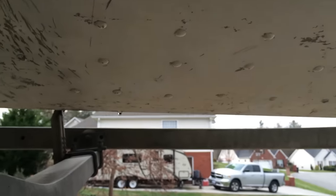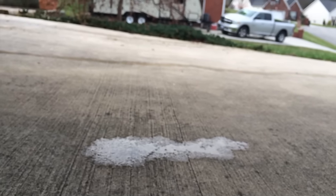We've let the water fill up in the bottom of the boat, and you will see a little puddle has developed here underneath the boat. As I get a little bit closer in, you can see some water dripping there. So that's a hole that I will mark and fill in with some JB Weld. Look for things like this in your boat, especially if you're around rocks — my boat gets a lot of use.